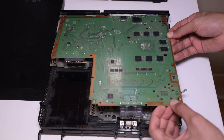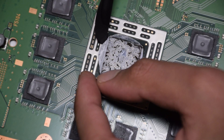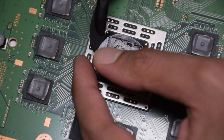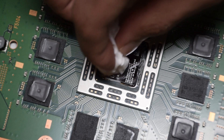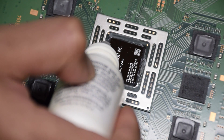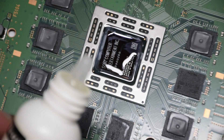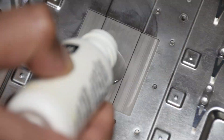Remove the metal frame and disconnect this tiny fan cable by gently pulling it upwards. Lift up the main board and rest it on a flat, preferably anti-static surface with the APU side up. First remove as many of the big dry chunks as you can, then using isopropyl alcohol on a paper towel, wipe the rest off the APU die and the area around it. If you're using Arctic Clean, apply a couple of drops to the thermal compound and let it emulsify for about two minutes before wiping it off. Repeat the process to clean your heat sink.